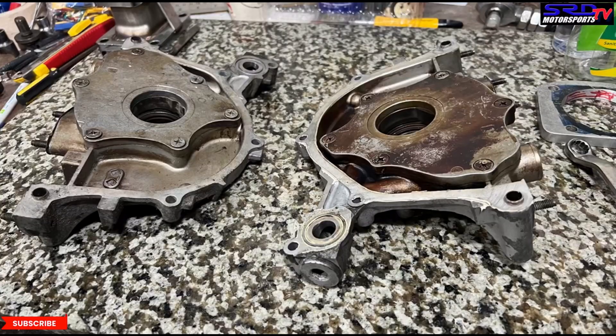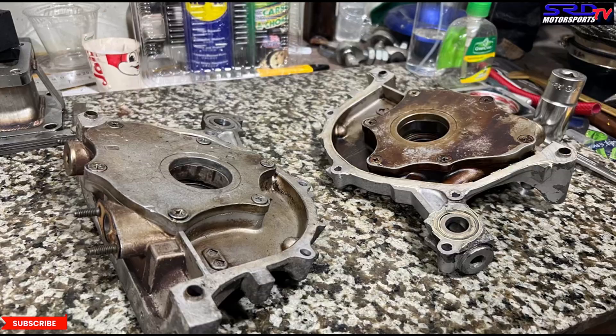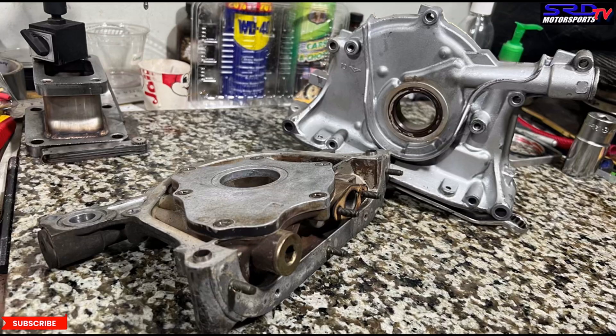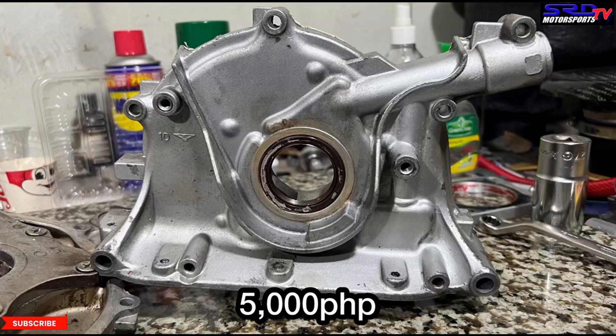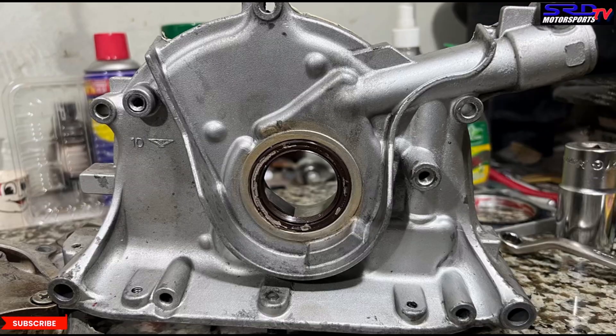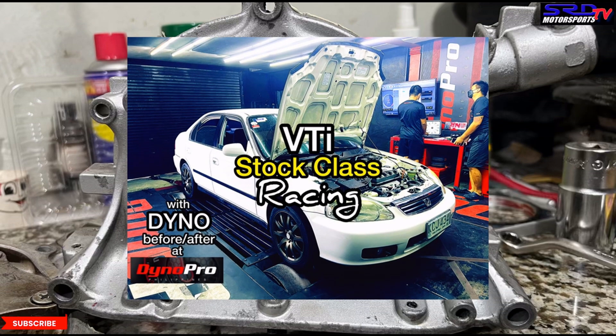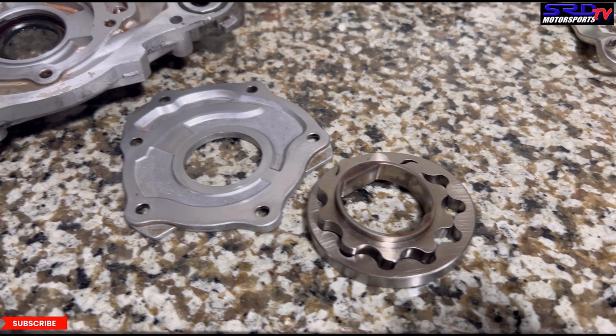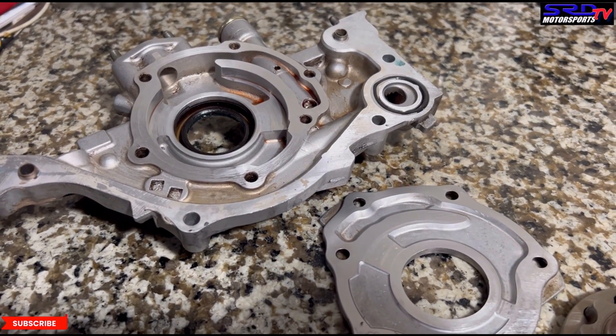The interesting thing is that since the 80s this has been standard practice for VW air-cooled engine builders — that's 40 years they've been doing this and it's been working. This is what we do on Honda oil pumps. For locals we blueprint your oil pump for 5,000 pesos — you can send us your oil pump and we'll do all the rest. This comes standard on all our rebuilds. Here is the D16Y8 oil pump from the latest VTi series — we disassembled it, and you can see on the rear pump cover the usual normal wear from a 97,000-mile motor.